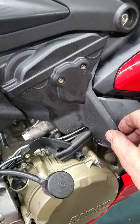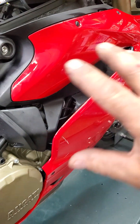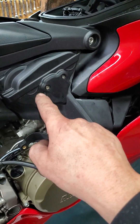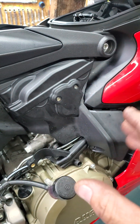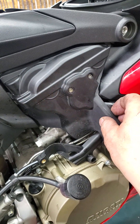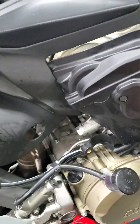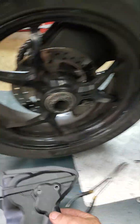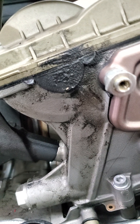It's going to be a little tricky if you don't want to take off all the fairings. The right way should be to take off all the fairings to make it easier to remove this cover. But if you know a tricky way, you can take it off like I did. Twist it this way and take off the cover. Over here you can see we found the leak — this is the leak.